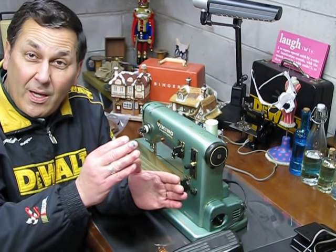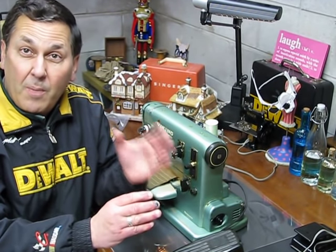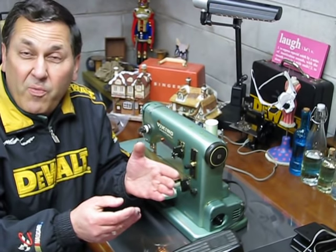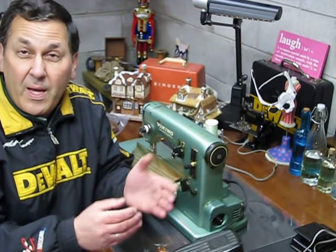You know, if it's equal, okay, but preferably you would want to have that foot control rated like for 1.2 amps versus just the 1 amp, because then the two are going to, almost like adjusting tension, like the bobbin carrier and the upper tension, they're going to kind of fight against each other with that amperage factor back and forth, and you're going to get either inconsistent performance or you're going to get underperformance from that machine.